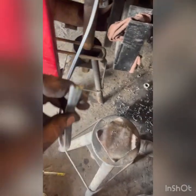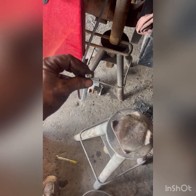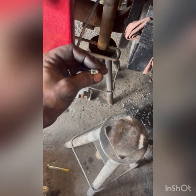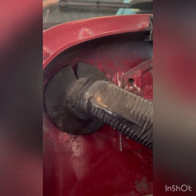This is the three-wire sheathed wire we're going to use, coming from the solenoid up to the toggle switch inside the cab, so we can adjust the ride height from inside. We've got ground, hot for up, and hot for down. We run this down in the wiring harness going back, up into the cab right here by the firewall, going in through that wiring harness.